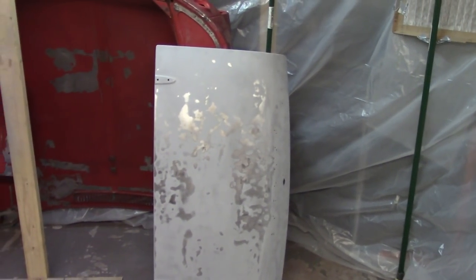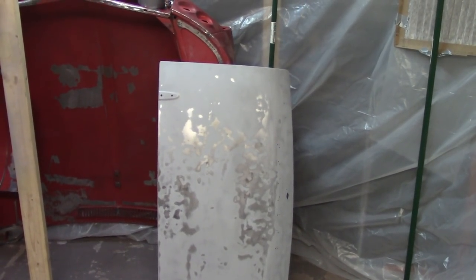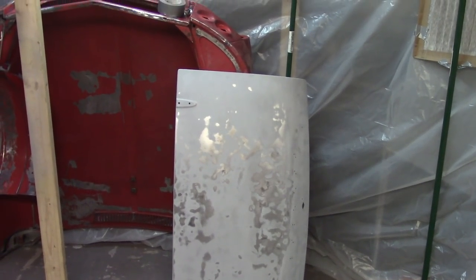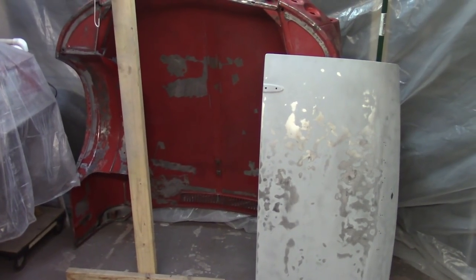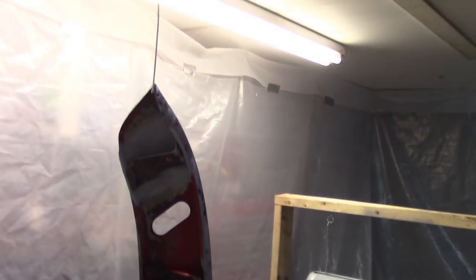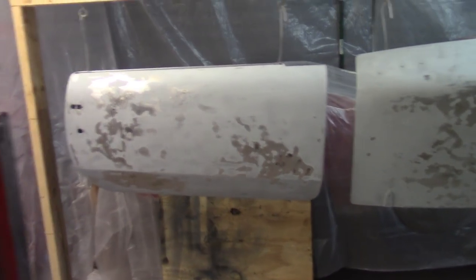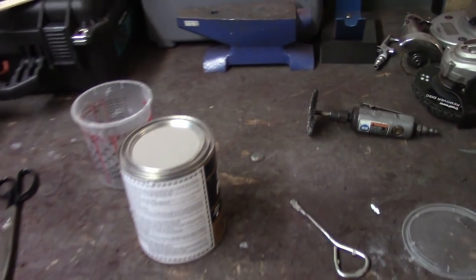High spots that would potentially cause me to continually sand the epoxy down to bare metal almost immediately — I don't want to do that. So we're going to take a look at that and hopefully start cleaning everything up and get closer to paint. Got the pieces sitting here patiently waiting — they've been hit with wax and grease remover a couple of times. I've got a solution for the front valance: just hanging it from a piece of wood up there. I'm about to mix the paint and I want to make sure you use a tack cloth before painting.